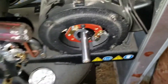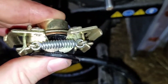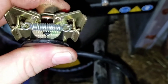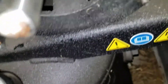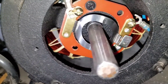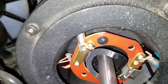I got that off. Here it is — as you can see, it's a centrifugal clutch. As it spins faster, the two arms come apart and that changes how this works down here. Sometimes what will happen is the contact points will get all corroded and it doesn't work.